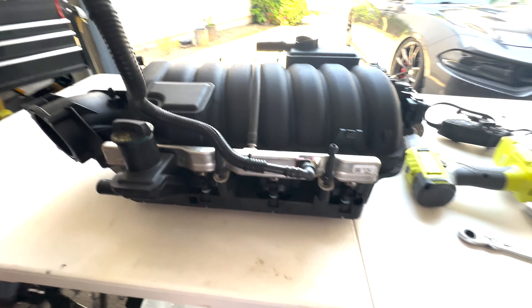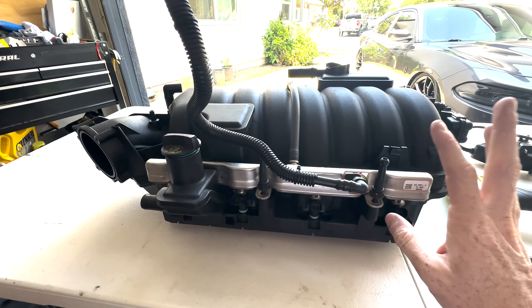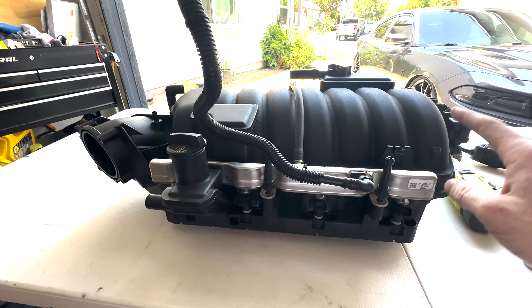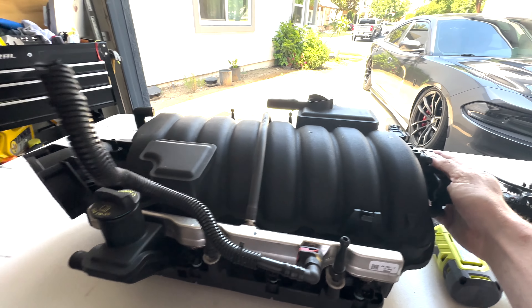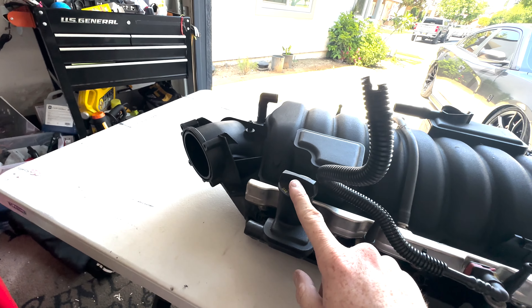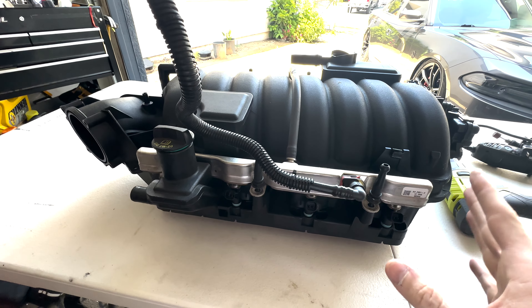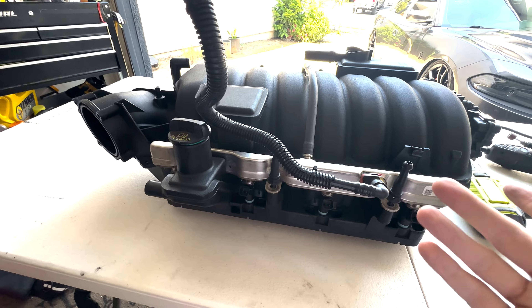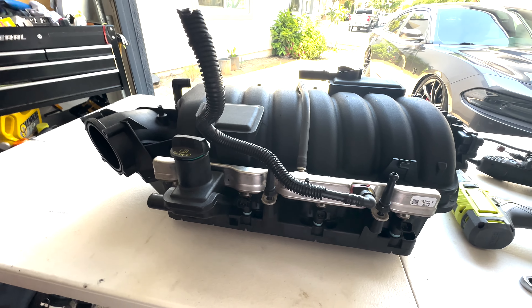To keep this as fair as I can, I'm going to go through everything start to finish. We'll start with removing the fuel rails, then take out the map sensor, take off the SRV, take off the elbow, and take off the cap. We basically want this to be completely bare because we're going to get all kinds of plastic shavings everywhere. When we're done, we want to rinse it and dry it, so make sure we remove everything.